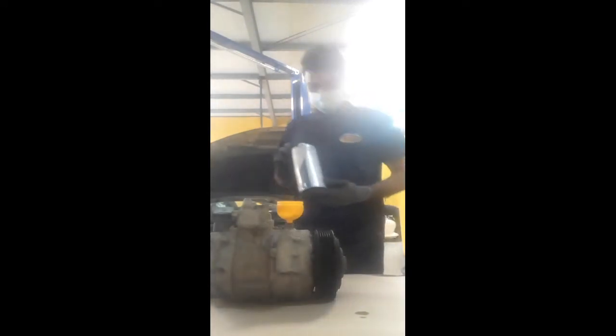I will tell you this also: for a normal compressor we use ND8 compressor oil, but in hybrid vehicles we cannot use ND8 oil. We use ND11 oil for hybrid vehicles, because in hybrid vehicles the compressor has a lifetime guarantee. It's a very sensitive compressor, and also a very high quality compressor, so we cannot take a risk. This compressor is a normal compressor, so that's why we use ND8 oil. This is the ND8 oil usage.